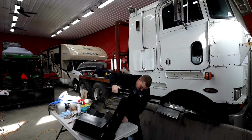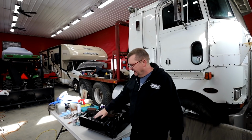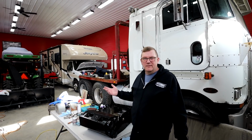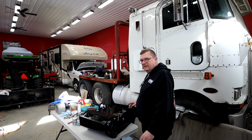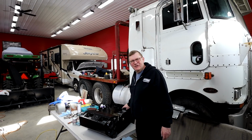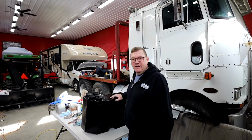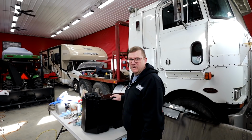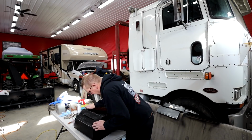Should have wiped this bench off, I guess. All that sanding. Now one of the things I did with this is I wiped it down with acetone, but I think from all the years of maybe Armor All or whatever, my paint kind of cat's-eyed a bit in spots, but you're not going to see it anyways. It just bugs me because I didn't think it should do that if I sanded it and cleaned it up. It's probably why bodymen do not like Armor All, because it wreaks havoc with trying to do paint, from what I understand. So, put this bad boy back together.